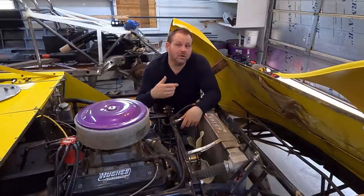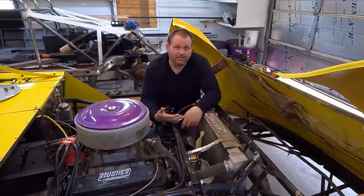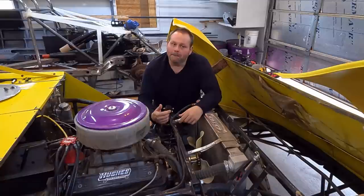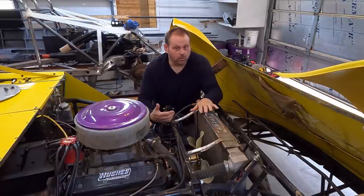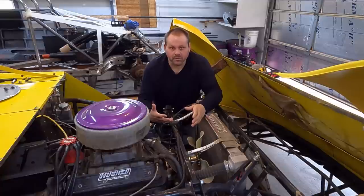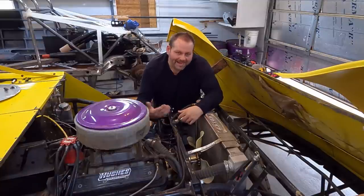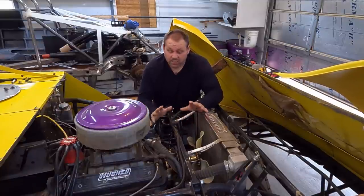That doesn't mean that you don't have a setup where you're able to keep the engine cool enough, because you can overcompensate in a lot of different ways, but you're chasing around the problem when it's an airflow issue. You can run a less expensive radiator or less radiator or a simpler setup if you just had an appropriately built fan shroud. I believe passionately about this. I think this is putting people out of racing for the season if they lose a motor over one of the least expensive things that you could build. And so that's what we're doing here.